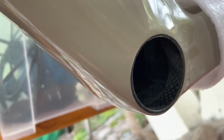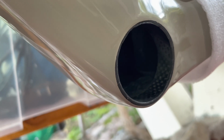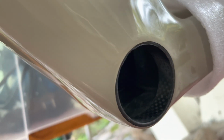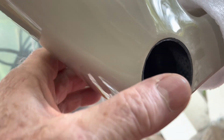So I told you I bought the Hambini engineering bottom bracket for this, and talking with him, one of the things he said, he did a drawing of what he calls a go, no go. And it's just a little aluminum puck that either fits in this opening or doesn't fit. And one side is 41.95 millimeters. And the other side is 42. The 41.95 should go in there. The 42 should not. And that's the case for both sides.